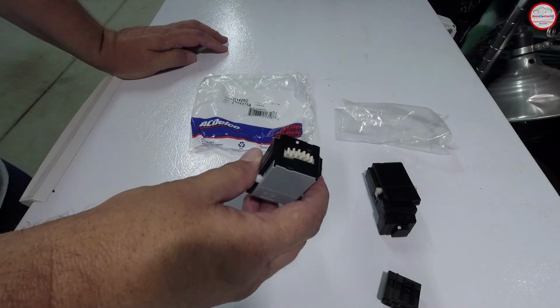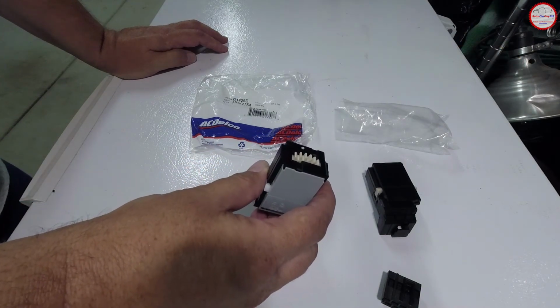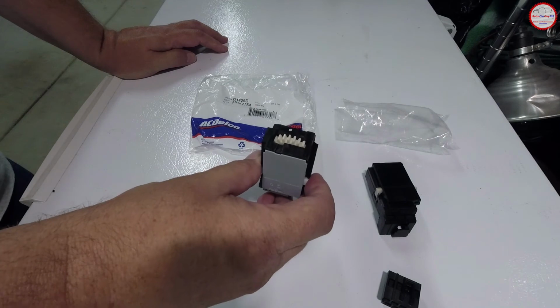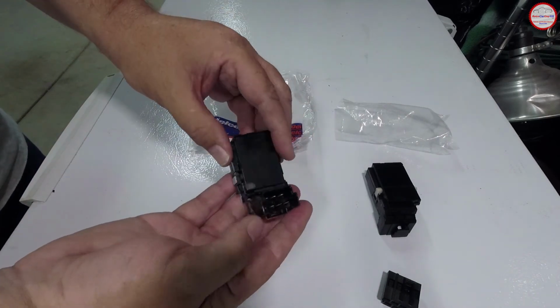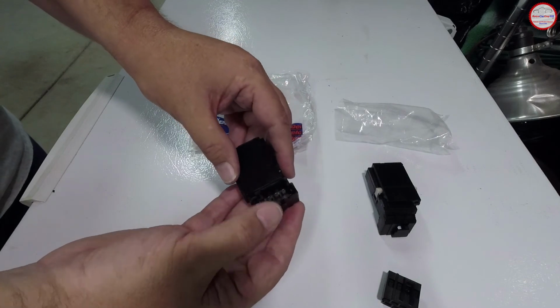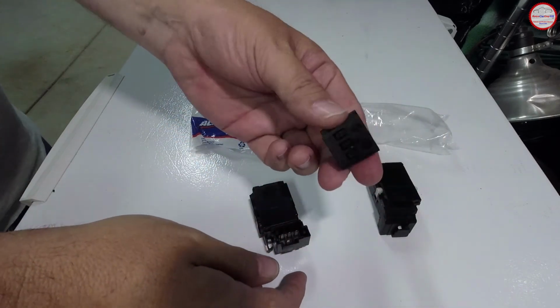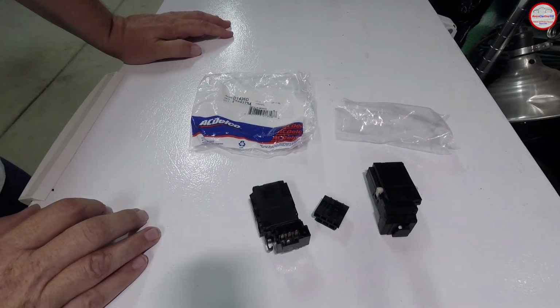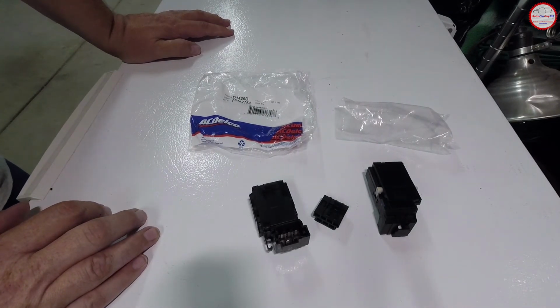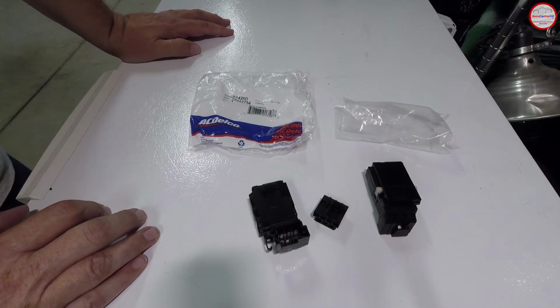So aligning the gear is a very important part of this, but that's the big cautionary items for it: getting this aligned correctly, and removing the connector from the original switch without damaging the connector itself on this part of it. And if you follow those simple cautions, getting it reinstalled and aligned correctly, you should have a new AC Delco ignition switch installed that hopefully is error-free.